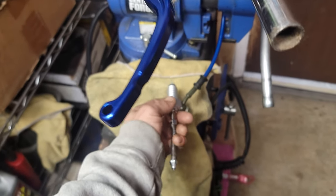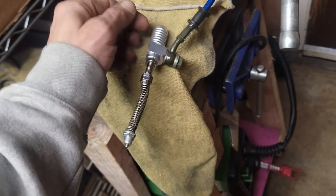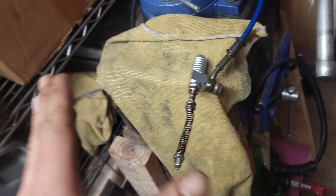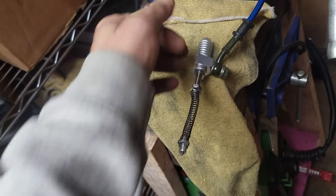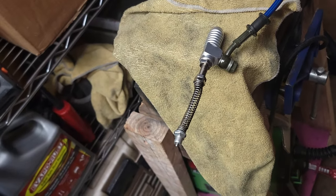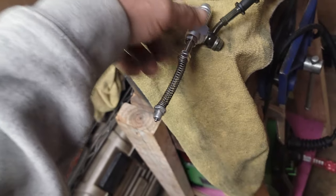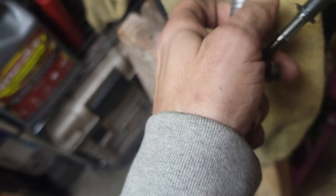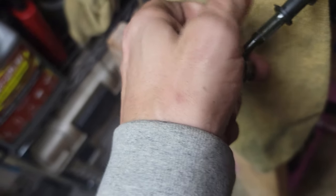So when you open up this back cap on the slave cylinder, there's a piston in there. My piston was flush with the top when I didn't know that was fully in. So I had issues at first of it not moving. Then I eventually figured it out and opened this up. What you want to do is make sure that this shaft is slid all the way out. You can check by opening up this cap and looking down in there, and you'll see a piston that's going to be down versus all the way flush. This would be piston down. You see how the piston's down in there? Mine was flush with the top originally, and that was making it not actuate.